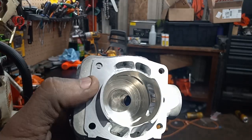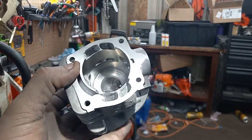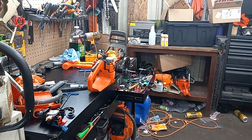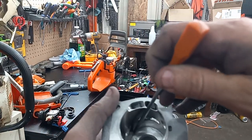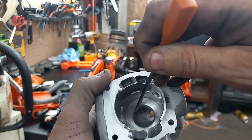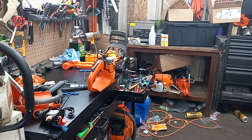Here's the lower work, the upper work, the lunged intake, my dual-stage combustion chamber. What I mean by dual-stage is from here to about right there is a flat band, and then from that ring up in here is on a taper — about like I do on the pistons. I cut about 55 out of the chamber and 50 off the base.